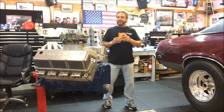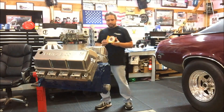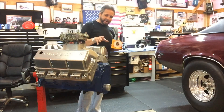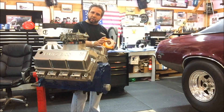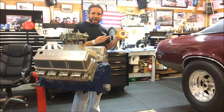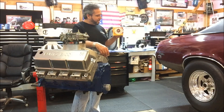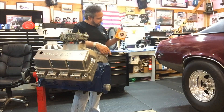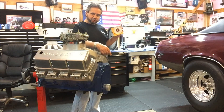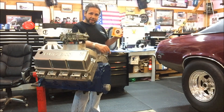Here's the gauge I'm going to use. I have a digital gauge but I don't like the way it reads — it's not calibrated perfect and I'm not going to mess with it. I want to get this video made, so I'm using this simple angle locator. You can buy them right at Walmart for about 10 bucks. When you look at this: nose pointed down is negative, pointed up is positive — same with the drive shaft. I'd like to have maybe two or three degrees of negative pinion, then we'll figure out what the drive shaft is, add them together, and that's what we've got.